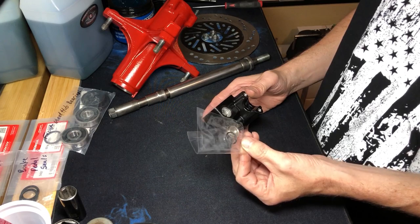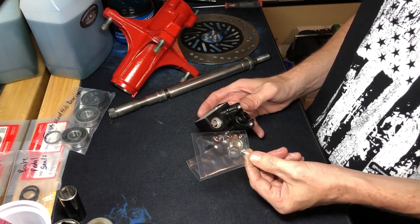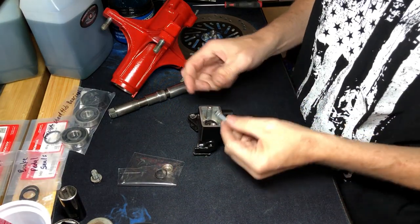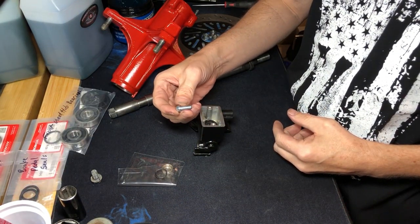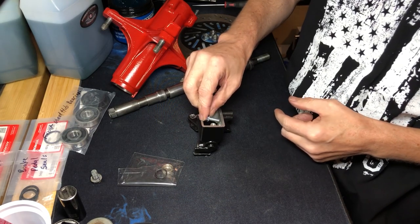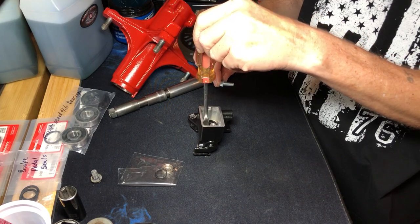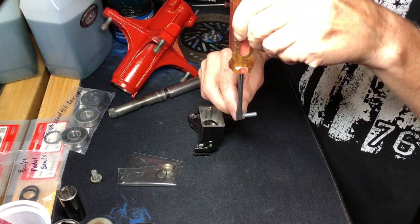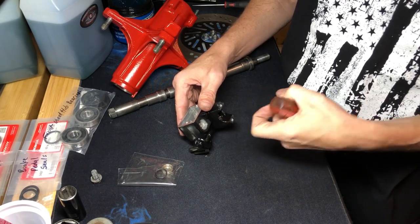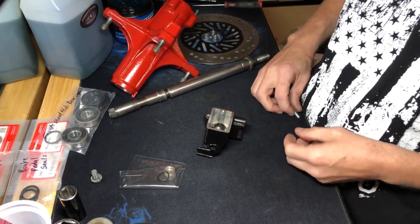They come in two packs. I'm gonna demonstrate how you pop this guy out and get a new one in there - hopefully. I did this once before - it's kind of a pain in the ass. Here's how I did it. You want to locate a bolt or screw or something that has a flat head on it, just enough to go into the window itself. We're going to use a flat head screwdriver - pop this in, rest the screwdriver on the back of the wall, then twist it. When we turn it this way it'll shove the screw forward and pop this window out through the assembly. Then we can put in the new one with the new O-ring.